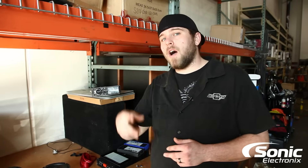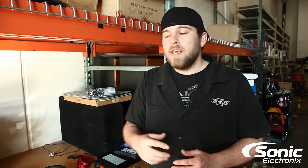The second question is: can I power two speakers off a channel that's being bridged? Unfortunately, no. Most speakers — door speakers, if I'm guessing that's what you have in your vehicle — they're four ohms. So if you wire those two in parallel, they're going to be a final impedance of two ohms. If you bridge the amplifier, it will go into protection and shut off. There may be an amplifier out there that can be bridged at two-ohm final impedance, but that's rare.